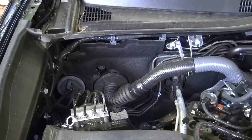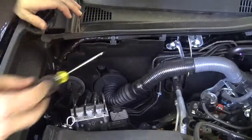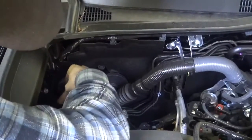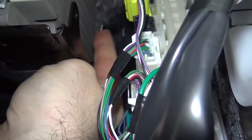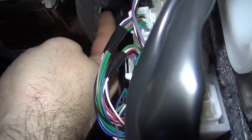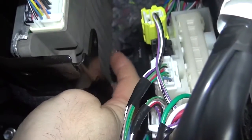One of the tips I always use to easily get through the firewall: you're going to find that there are many grommets in the firewall already. Right here is a good example of one. Taking a standard screwdriver, or even a Phillips head screwdriver, and just pushing through it will get you inside the car. The screwdriver came in from the outside. There are two benefits of using this method as opposed to drilling through: one, it is self-sealing from any elements, and two, it doesn't have any burrs that you have to worry about digging into the wire.